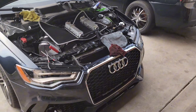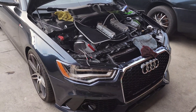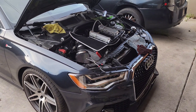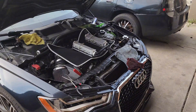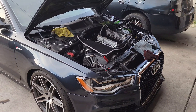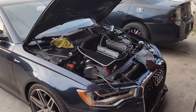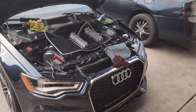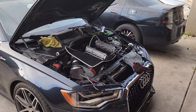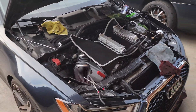Right before the quarter mile it starts breaking up, so I did it two or three more times to confirm. I pulled over, could feel the car idling bad — rough idle. Turn it off, started back up, car runs perfect, EPC light off, no engine lights. Did it again, same thing — EPC light comes on, always at high RPM at top of a run. Happened about three times, so I went home and scanned it. I had cylinder misfires in one, three, and six.